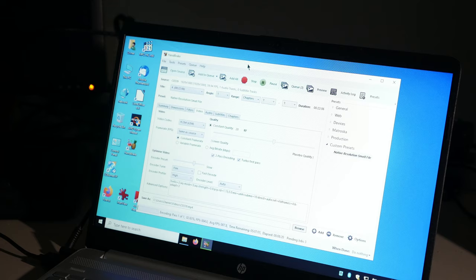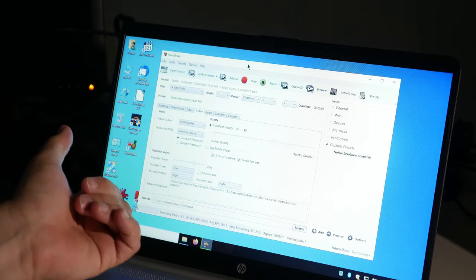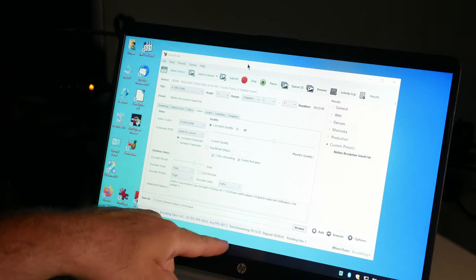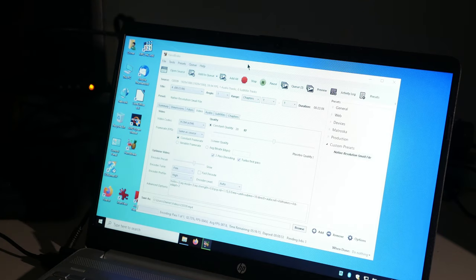So what I think is happening is that while it started off with an initial frame rate near 10, the chip gets warm, and it doesn't have as much thermal margin to work with. And now the FPS has gone down. The Intel 6700HQ i7 in the other room is currently chewing away at this at an average frame rate of 8.4, although it lingers a little bit lower. This one's average just keeps going down. And that's not nearly as great as I thought it would be.